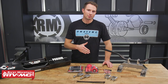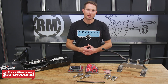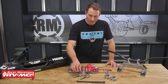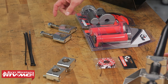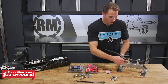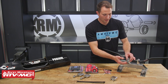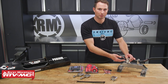To help you update your 7/8 inch bars to oversized bars, we offer convenient kits on the website for pretty much any bike. Just type in your year, make, and model, and you're going to have a couple different clamping options. This style is a removable bar clamp — you just reuse the stock rubber bushings. But this other style, if you have a triple clamp that has the bar mount as part of the triple clamp, you'll have to install this adapter, which will raise the bar up a little bit. So you might want to order a shorter bar if you have this style of triple clamp.